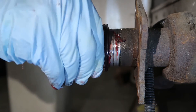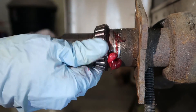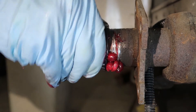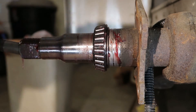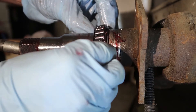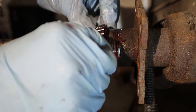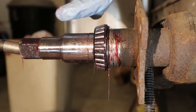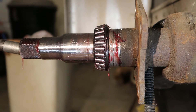After I've cleaned that grease off, let's try this some more. The issue here is that that hole is covered up partially by the inner surface of this bearing. So very little grease can make its way into the cavity of the hub to then work its way to the outer bearing — very little grease can make its way to the outer bearing.